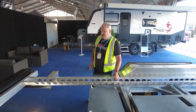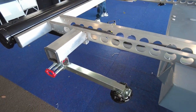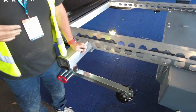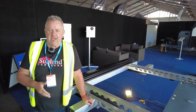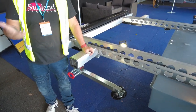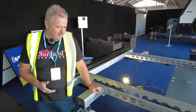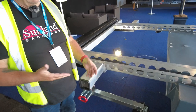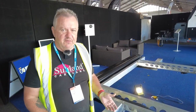A couple more features on the chassis: we've got aluminium outriggers on the outside with special components. One is designed for the legs — you'll notice the leg is swung forward. I constantly hear of people swinging legs backwards, told that if the leg drops down it can flip the caravan. That is complete and utter nonsense. If this leg were to fall down while in transit — which it can't because the latch stops it — the worst case is you lose the leg. By swinging it forward there's less chance of damaging the leg, and it preserves your departure angle at the rear, which we want to keep nice and high.